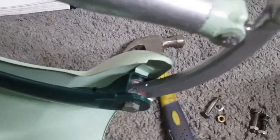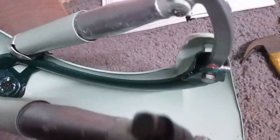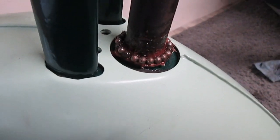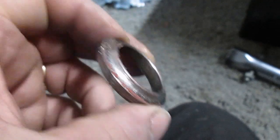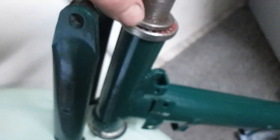So that I can bolt the bottom of the mudguard to the swing arm. That takes a bit of time and a bit of pulling and dragging — it's not easy to see where the nut is inside there but there's a special compartment for it. The nut is inside in that little container there, so it just takes a bit of time — it's fiddly, but it's on now. 21 5mm ball bearings now to be installed and they're held in position by that cone. 21 5mm ball bearings on the top section there as well. The next piece is part of the ball race and it keeps the ball bearings in position, like so.